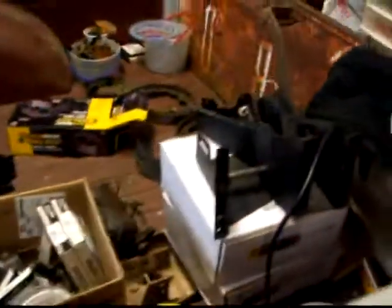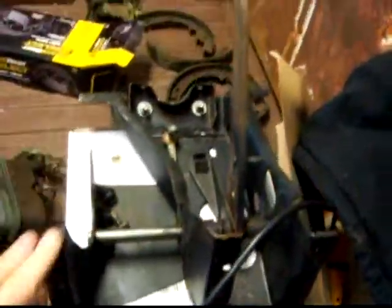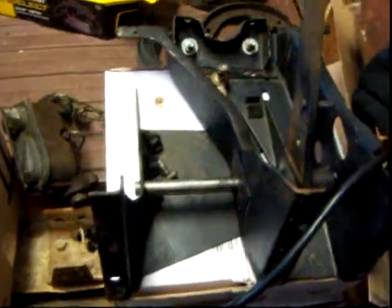Anyway, I pulled the brake assembly out that goes up under the dash for your brake and clutch pedal, and I removed the clutch pedal that was hanging here, and then cleaned that rod up on the bench with a wire brush and bench grinder, and then I greased it all in here so it works really nice. And this is your push rod to your booster. Anyway, I'm gonna POR that all today and get that done.